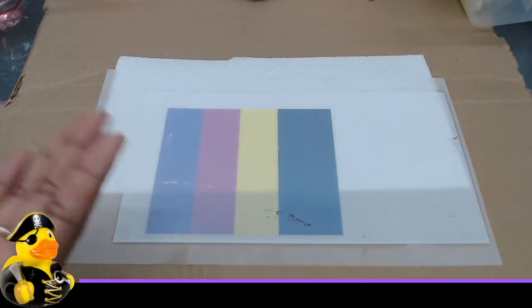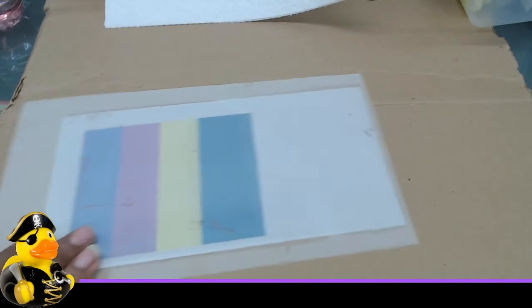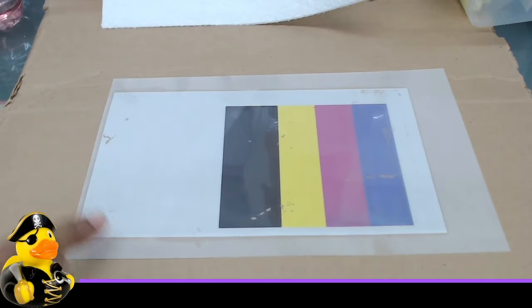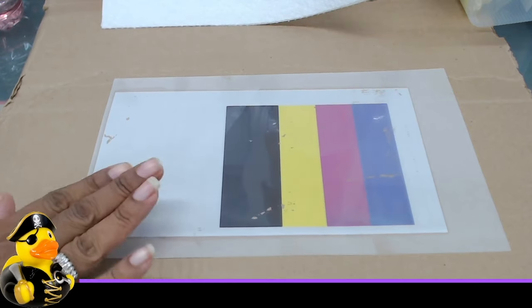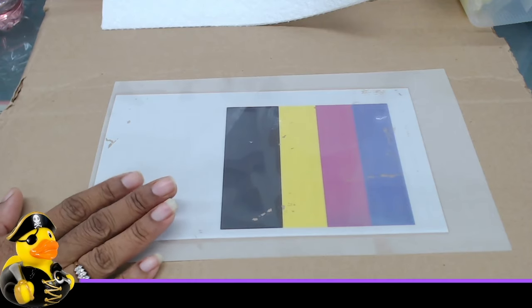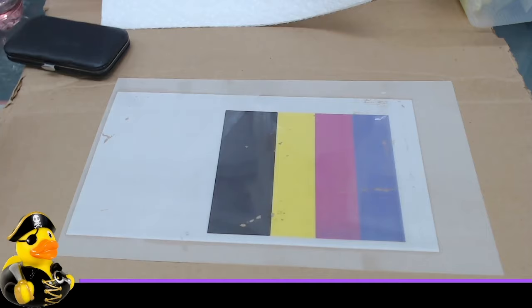I have a bad habit of letting it sit and not printing anything. How do you know when your printer needs to be unclogged? Here is a printout from a purge. This is old, so some pieces are missing and I never cured it. But this is the printed side. As you see, a DTF printer prints white, and the white ink here isn't very strong.